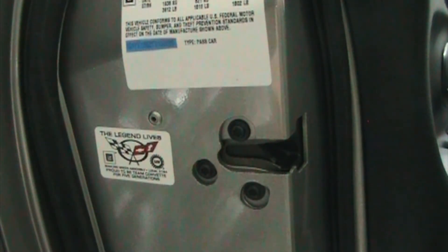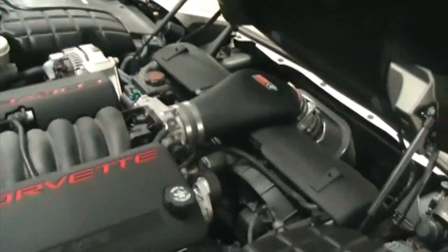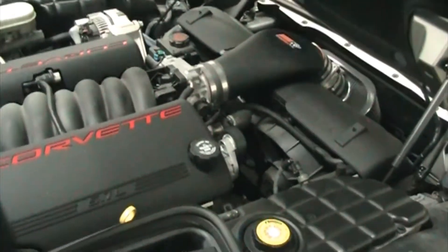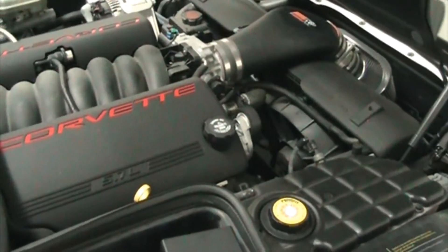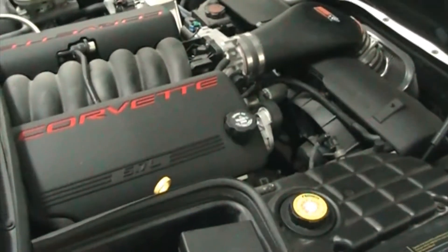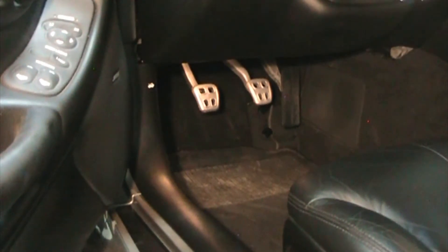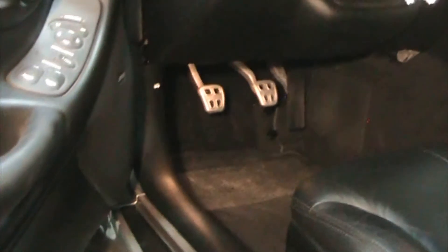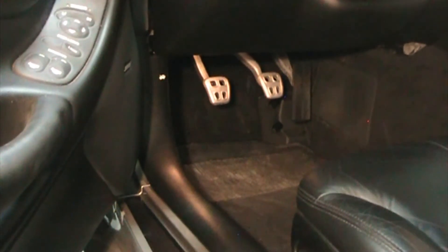Now you're safe to slam the door without breaking the latch. If you have a car with a hood latch open sensor, either latch it with a screwdriver the way we did the doors, or unplug that sensor and take a paper clip bent in a U-shape and plug it into those two connectors to simulate it being latched. Then go ahead and lock the car with the remote but leave the doors open - that will set the alarm and begin the timer for all the modules to go to sleep.